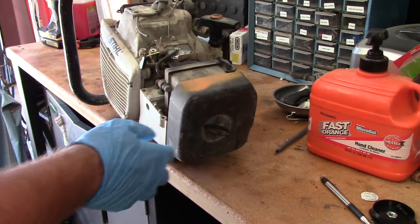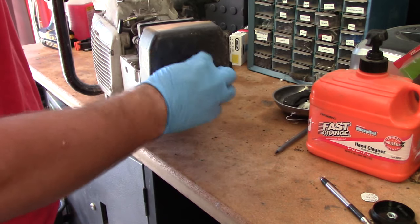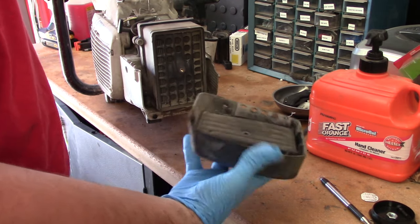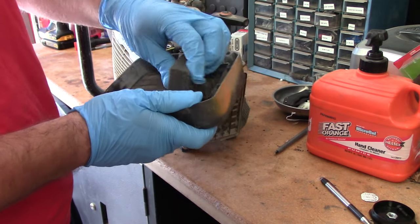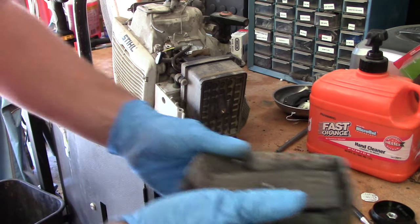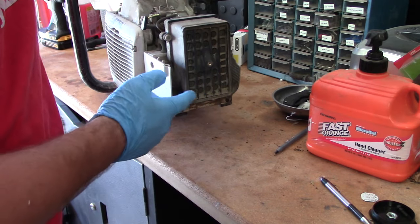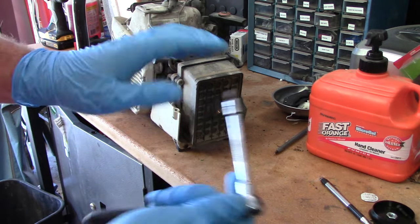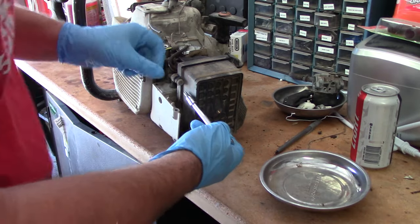The very first thing we'll do is remove the air filter. To do that, you just pull this back cap off. So we have a pre-filter here which definitely needs to be cleaned out — we'll save that for an off-camera job. Now we have the inside. We're going to need one Torx bit for four screws here to pull off this cover. I'm using a T27 bit.